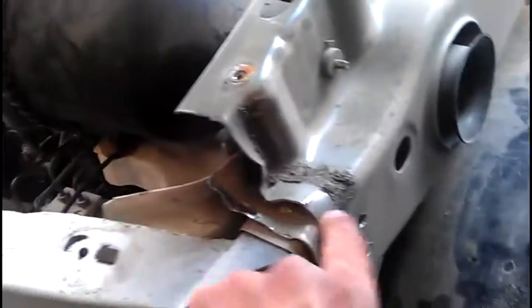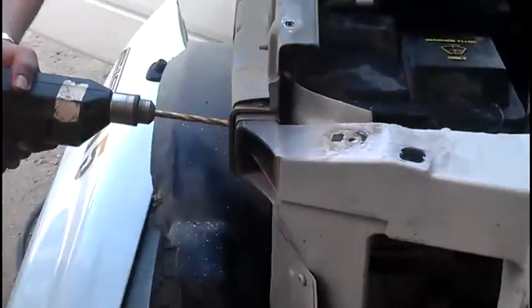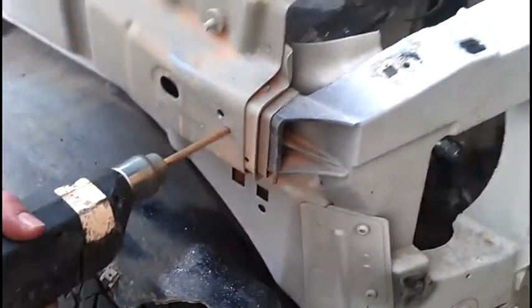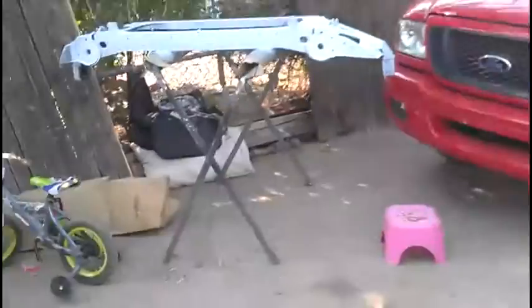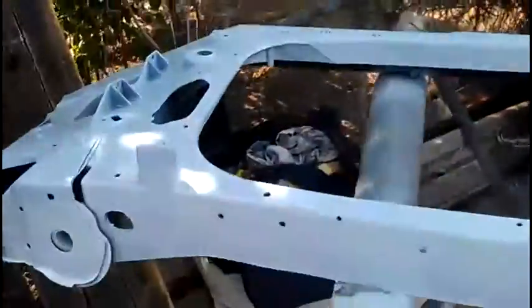Check it out — we're going to have to take off this radiator support. What we're doing here is drilling out the welds. It slides in there; I got a couple of welds at the bottom I've got to take off on this side. You can see what the end is doing over there — they're drilling out the welds. We got the other radiator support — there it is, got it all painted already, ready to get slapped in.